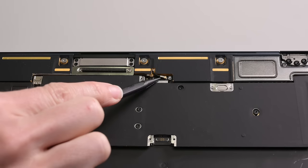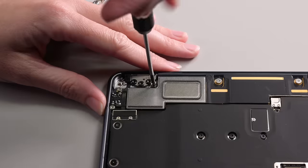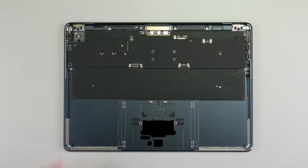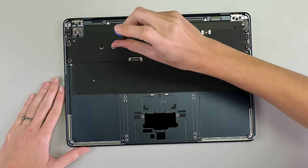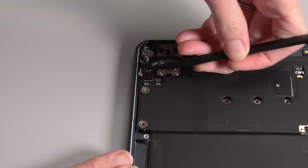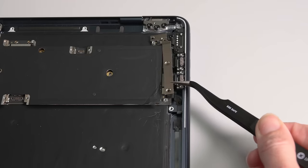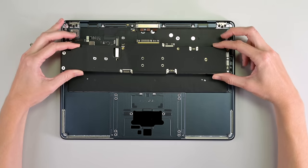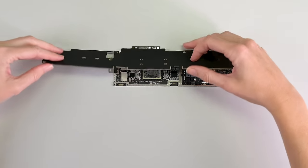Reaching the logic board means removing brackets — antenna brackets, hidden screw brackets, screws, more brackets — and out popped the combination speaker antennas. Now the logic board. There are a lot of screws in here. In this corner, we've got the Touch ID connector. Up here are some display cables. And the excellently still-modular ports are right over here. One more connector, and the board lifts out. This shield is clipped on, so off it pops — no screws.